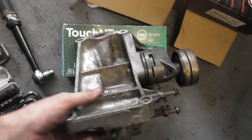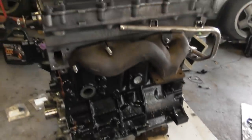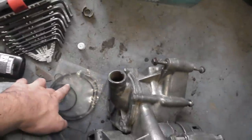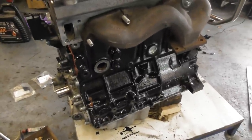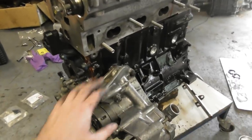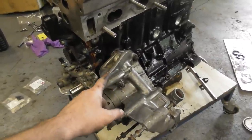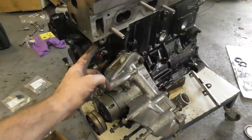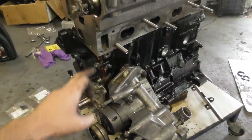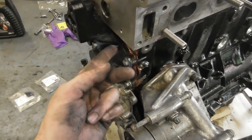Next I'm just cleaning up the front cover and water pump and power steering housing that seats against there with an O-ring. Using Hylomar Blue just to seal that, then I'll bolt that on and torque it all up. I think I'm continuing my two steps forward, one step back process. Just bolted that alloy housing on with a bit of red sealer around the O-ring between that and the block. I'm not convinced it's the greatest stuff in the world — all of this bit I did yesterday — and fair enough it's a non-setting compound. But Hylomar is also non-setting but a lot more resistant — it really beads up and goes fairly hard.